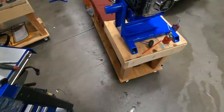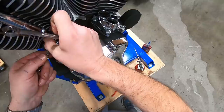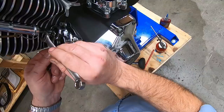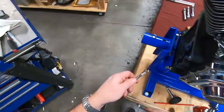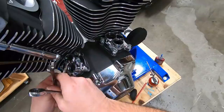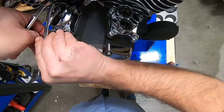All right, now let's grab a wrench. It's a 7/16. Once you put this wrench in place here, do not move the quarter inch wrench. All right, we have zero lash. We've confirmed it. Now we're going to count our revolutions of that mark. Do not allow the bottom section to turn. This is where things get a little bit tricky and people can have a hard time doing this. You're going to need two 7/16 wrenches. You want this one in place to keep the bottom from turning. You want this one on the top, and also hold them both firmly so neither one of them turn. Now you can lock your lock nut.